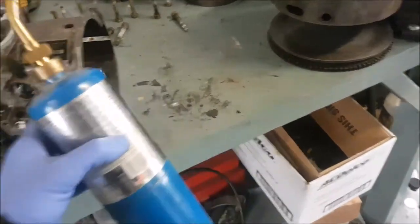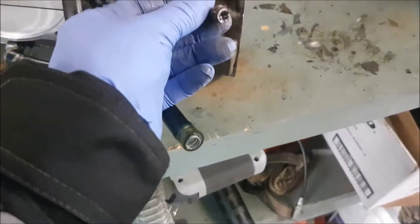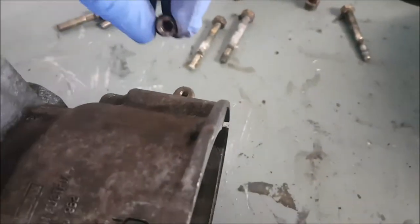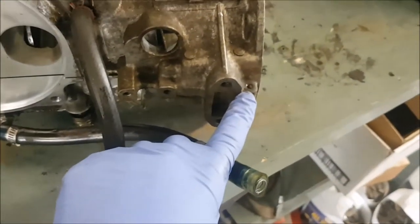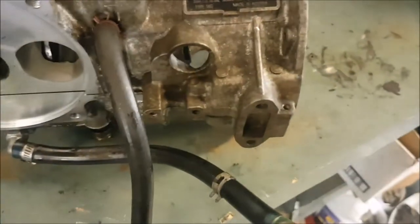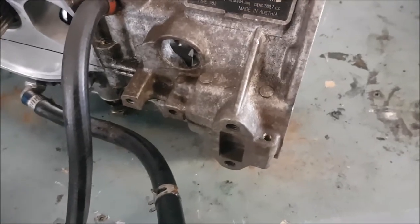Just a little torch — you don't want anything too hot when you're heating aluminum, you just want it to warm up. I had to beat and smash the torx bit into there, and finally I was able to crack it free. The other side wasn't as bad — I was able to get that off with a couple good snaps of the ratchet. This one here everything just kept slipping, so I ended up smashing a torx bit into it and hitting it with an impact, hoping things wouldn't break, and it managed to crack it loose and spin it out.